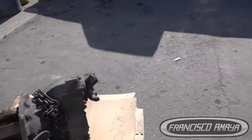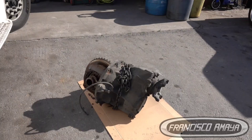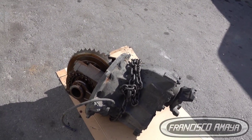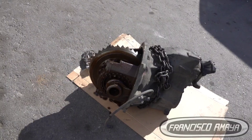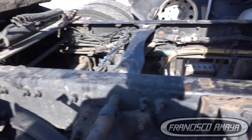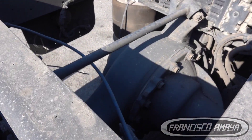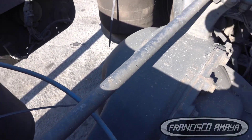If you use a different ratio differential, you're going to have problems with power distribution — it's going to destroy the differential as well. The wheels will spin at the same speed as before but the differential won't match, creating problems. The truck will also lose power, running a little slower or faster, causing new problems. There is nothing else to do for this truck right now. Since the front differential is out, we need to go to the rear differential and do a service — replace the fluids.